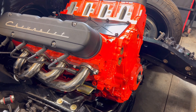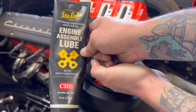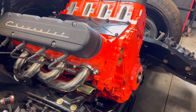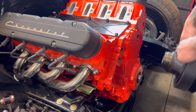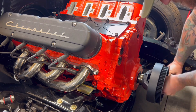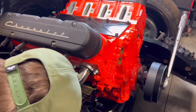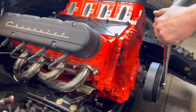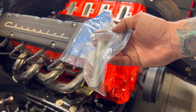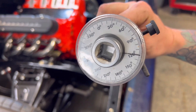Remove the original bolt first, then remove the damper pulley with an LS-style puller. Apply some lubricant to the bore of the new damper hub and also the hub side of the original bolt head, using an installation tool like the ICT one linked in the description. After you get the pulley on, install the original bolt to 240 foot-pounds of torque to seat the pulley on the engine, then remove that bolt and install the new bolt to 59 foot-pounds of torque, then use a tool to turn it 125 degrees clockwise.